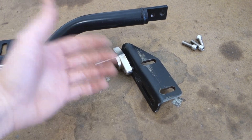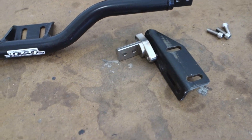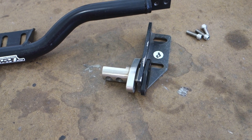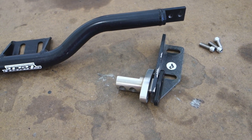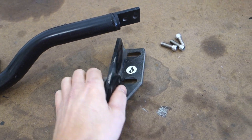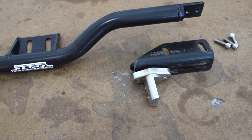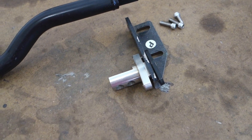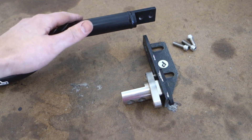There's probably an engineering reason why it is the way it is, so maybe they can't do it that way. But for people putting in replacement floor pans, you definitely just need to be aware of this issue. That's not going to fit if you use the AMD replacement floor pans like I did — you have to make it fit. And you've got to make sure your body mounts are in great shape. There were some good comments on my videos about flipping the brackets down, which is kind of where I got that idea. The issue is that by the time you put these pieces on the end, the overall crossmember is wider than the subframe, so I can't modify this bracket to fit between the subframe. This would have to be something SpeedTech would have to change — shorten this up a bit and extend this flange out.